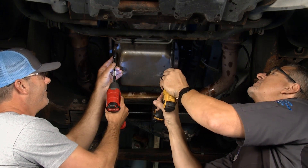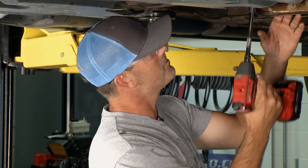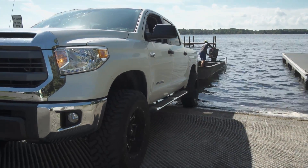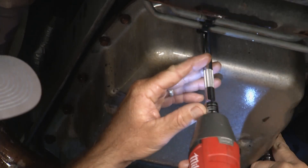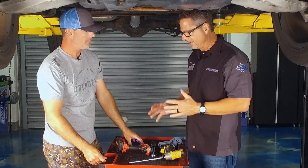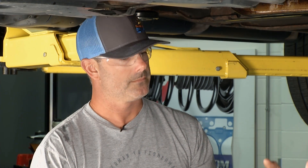It's fun fishing out there, but do you have any questions for the automotive guy? Something I've often thought about but never heard a good answer to: when I'm towing my boats — I have two boats. One is a really lightweight skiff, so I normally tow it and drive just as you would normally. But I have a big heavy center console, and when I tow it, should I use tow-haul mode? I do use tow-haul mode, but what does that actually do? That's a great question. Tow-haul mode basically increases line pressure — what line pressure is on a transmission. Think about all those clutches they showed you earlier, and it has to squeeze those clutches. It squeezes the clutches and makes them nice and tight so they don't slip. When you're towing, especially with your heavy boat, it kind of increases that line pressure.